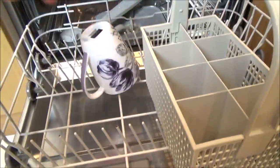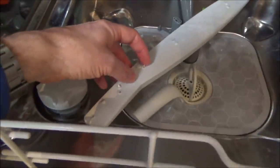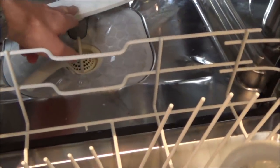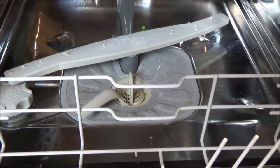The bottom one's quite hard to spin and there's a lot of damage on it from knives dropping down and catching on it as it spins, making those marks. There's also something sticking out of one of the holes. I think I just need to take the arms off, clear all the nozzles, get a hose pipe through there and a needle in each hole to get every single one clear.